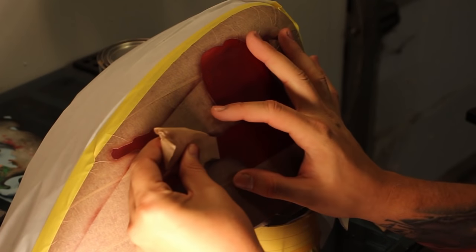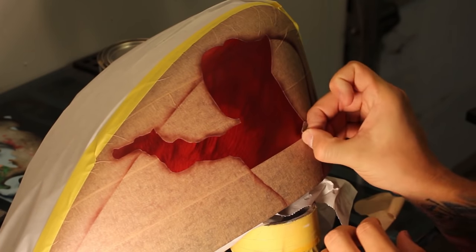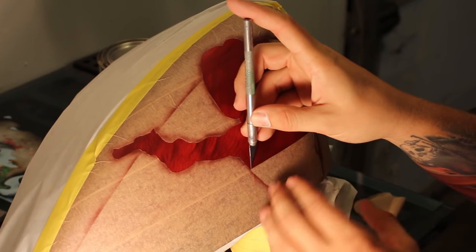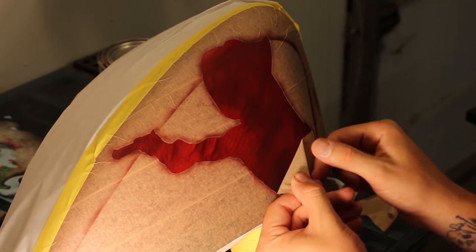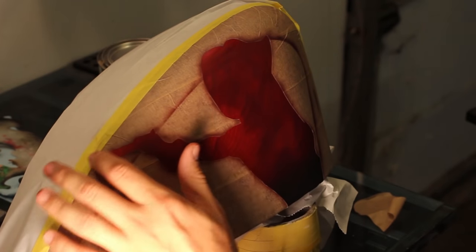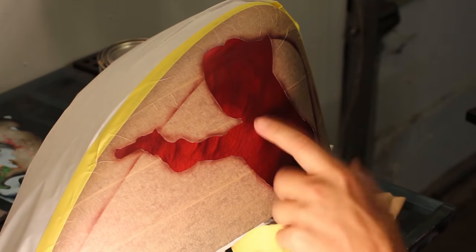You want to pull against the tape like back like this because it slices it on the edge so it won't rip and pull up. I've been in the paint and body industry my whole life and there are times when guys — like window installers on freshly painted cars — rip all over the place without unmasking properly and you get messed up areas. In collision repair especially, you're in a hurry when masking so sometimes you have little imperfections and pulling tape wrong will pull paint up and make a mess. Unmasking is not like Christmas morning — you don't want to rip it off real fast. Now make sure all your little areas are pushed down because we're about to spray a lot of paint. I'm going to get my color ready and do the next step.